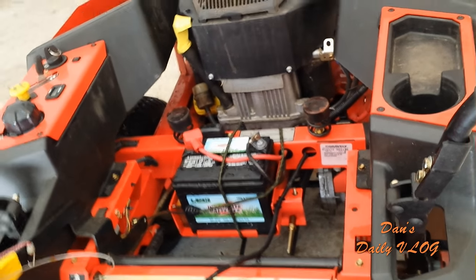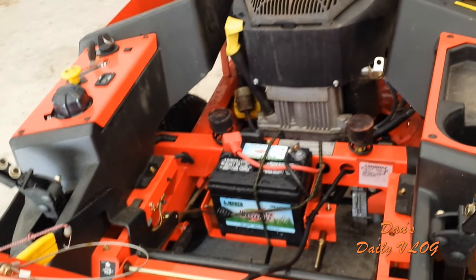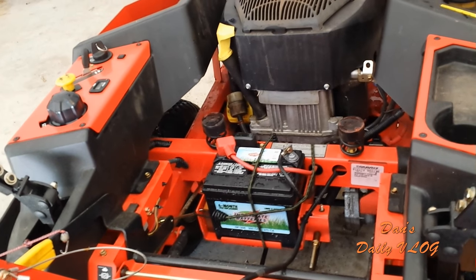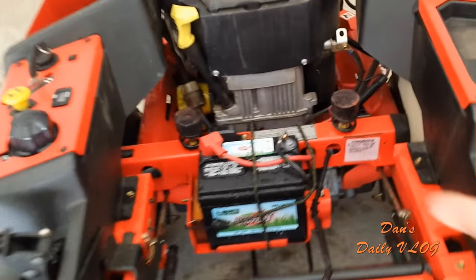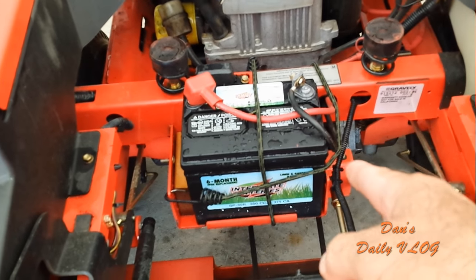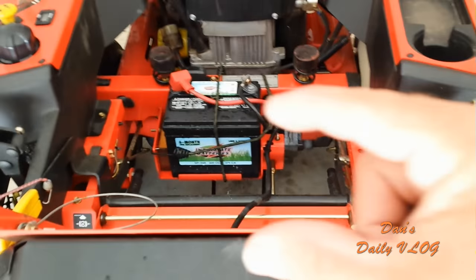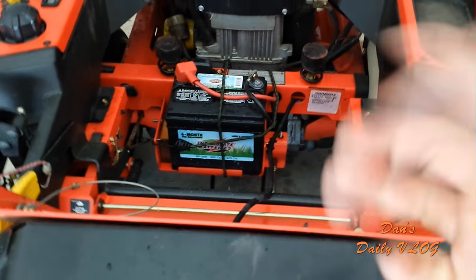If you find a dry cell battery at like a Batteries Plus or something like that, it's not going to be the same — it's got a different mount on it. So this way, the SP-35R wet cell battery is easily replaceable. The strap that comes to hold the original battery does not fit with this big tall battery, so I just put a bunch of cord on it. It does clear the seat — there's about this much space between the battery and the seat, so you're fine.